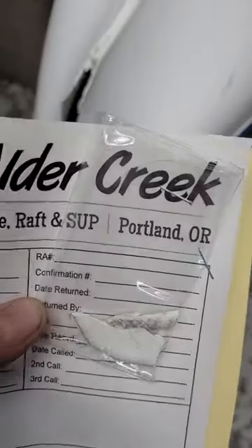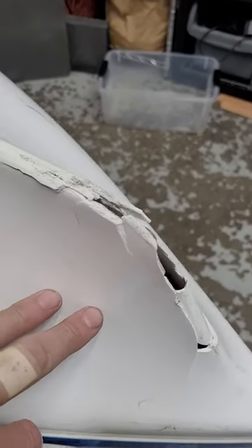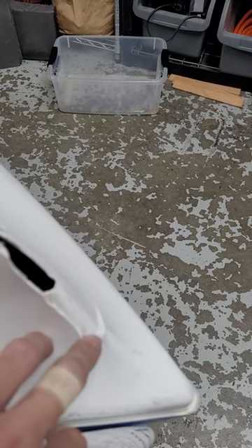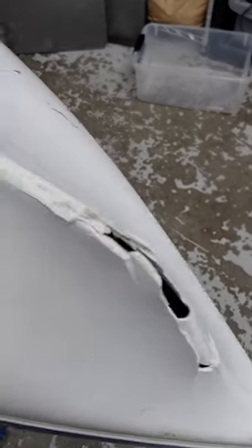A customer even found most of the spare pieces to fill that in. So to fix this boat, first we're gonna have to drill out the ends of the cracks to keep those from running, get everything to line up again, and then we'll channel out along the cracks for some extra adhesive.